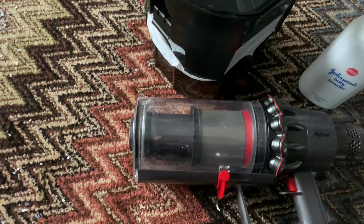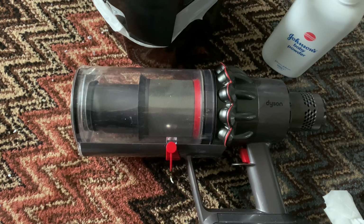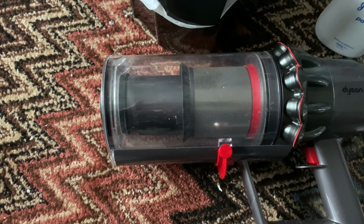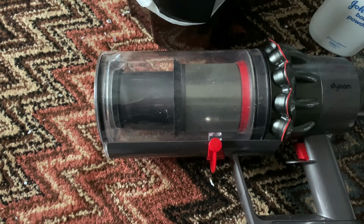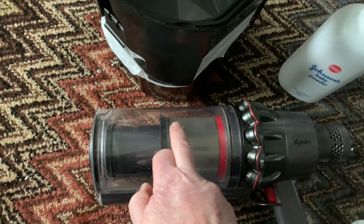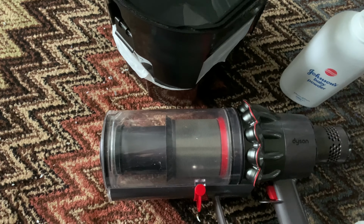So thanks for watching. Just a little informative video on how I actually clean my bin and how I actually clean the V11, or most cordlesses. Even after 2 years, if you keep wiping the bins out and cleaning them, they work better as well, because once these bits here get gummed up, that's where you lose your airflow. So you obviously want to keep them clean.